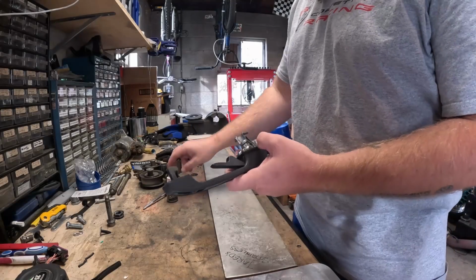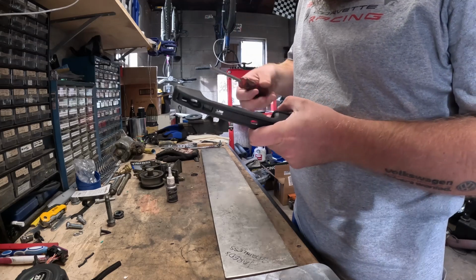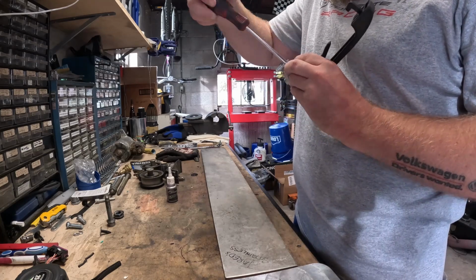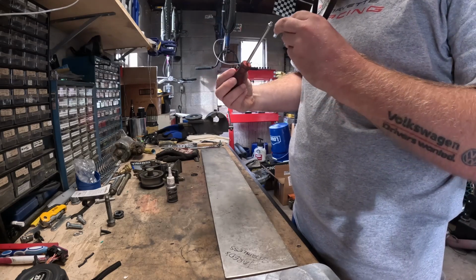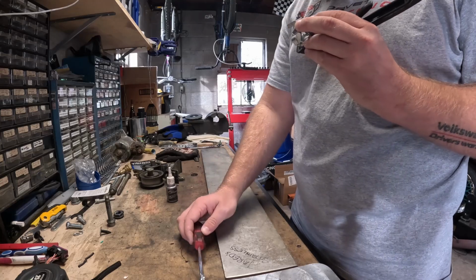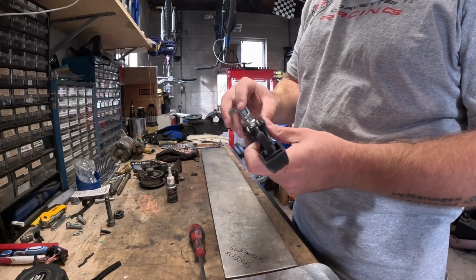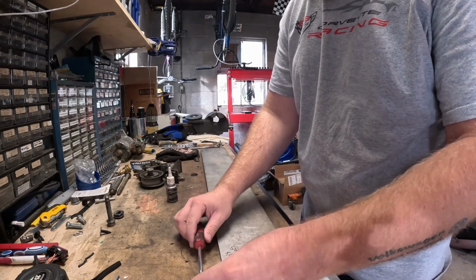I tried to be very gentle and delicate with this as I was taking this screw out, because there's a spring underneath that Y piece that basically helps it return back to center after you've spun the key to lock or unlock the door. And when that whole assembly explodes apart, that spring is incredibly difficult to try and get back into position. I remember fighting with it a lot when I rebuilt these door handles to rekey them in the first place.